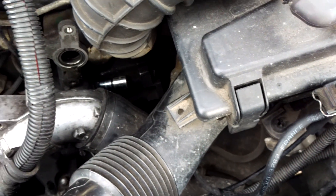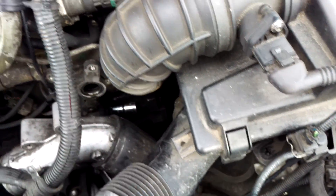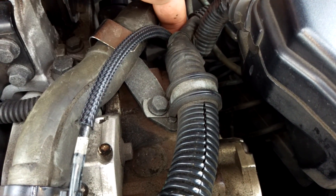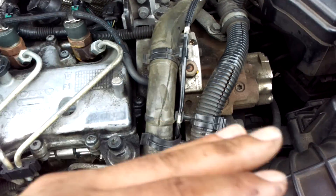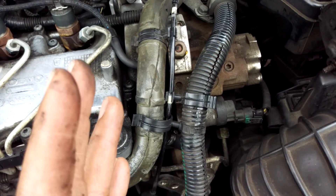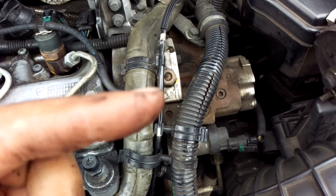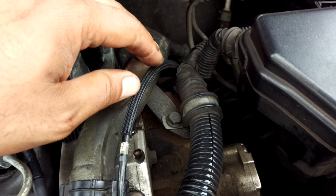So if you've got that D5 popping noise on a Euro 4, your options are quite limited. You can put a vacuum tester directly onto the vacuum pump with the engine running, and you just want to check the needle goes to full reading on the vacuum tester and holds there. If you've got any flickering of the needle, then you've got a leak in the vacuum pump — one of the seals.